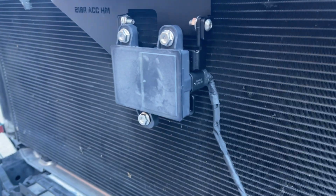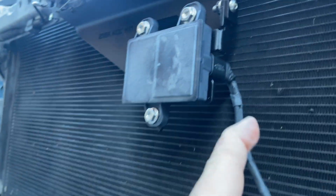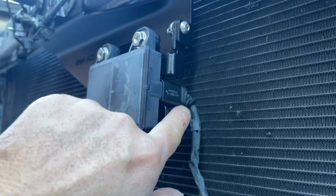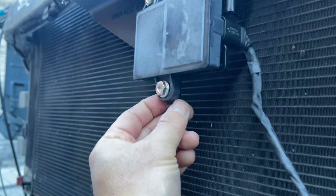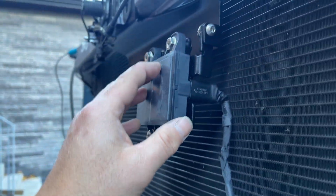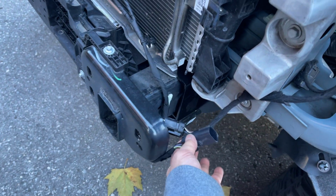Okay, when installing the adaptive cruise control with the Bodyguard adapter, know that your wiring harness will probably touch a radiator, and make sure you plug in the wiring harness before attaching this to the bracket, because it gets kind of hard with all these little spacers and stuff to do it while it's on there, which I just did. So I separated the 2 cables, one going to the active shutters on the lower shutter valence, and then one going to the wiring harness into the car.